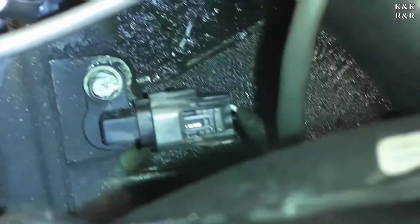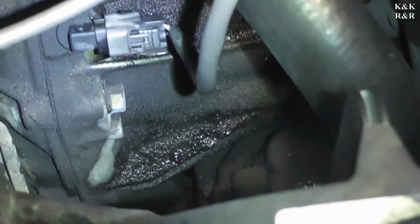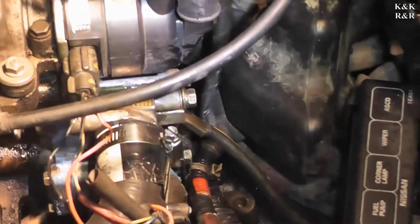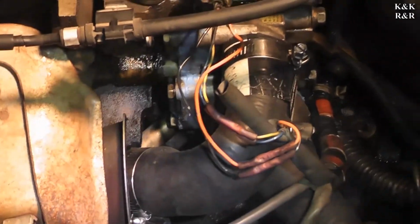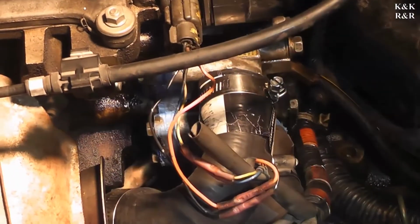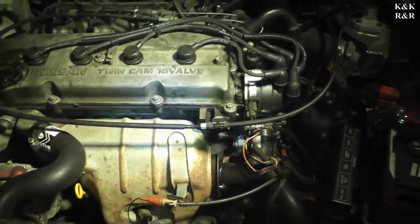But if you look down at the bell housing, you can tell this has been going on for however long that distributor was. A little bit of air mess in the water. That's okay. That's going to happen. But we'll see this one again. We're going to be fixing this oil leak. But she's got to get back to work, so we don't have time to fix it this time around. But as you can see, it's running. We got the water system hooked back up. We're burping it right now. Other than that, we're going to send this thing off.